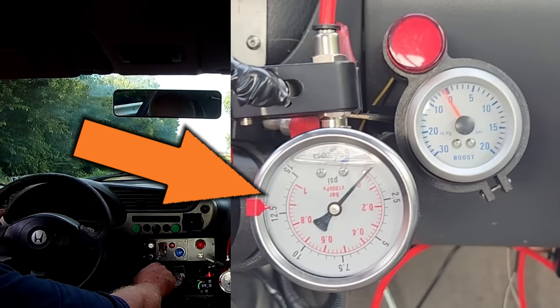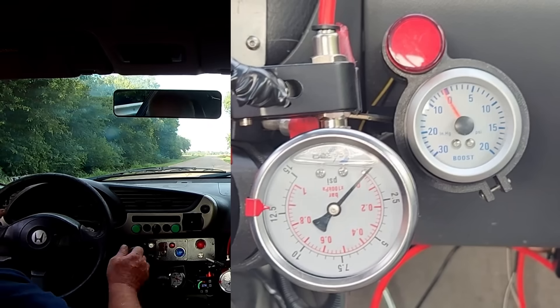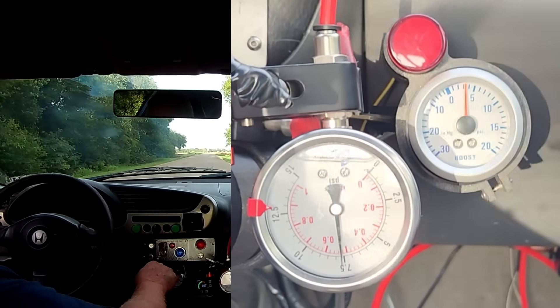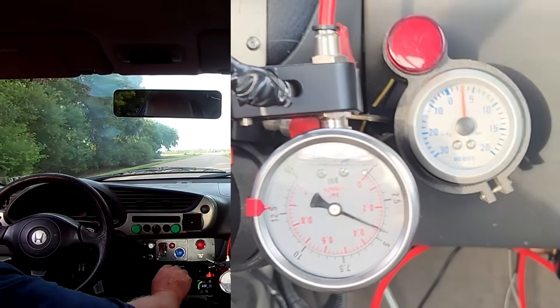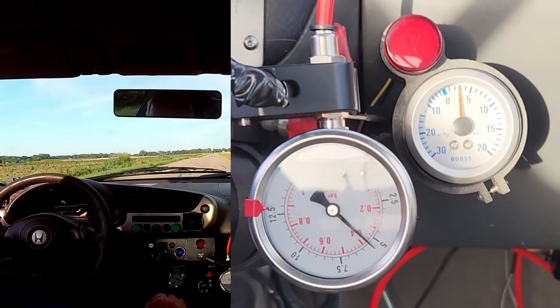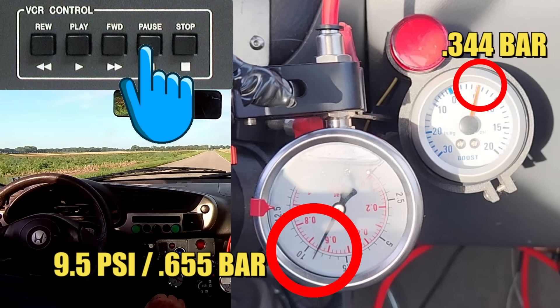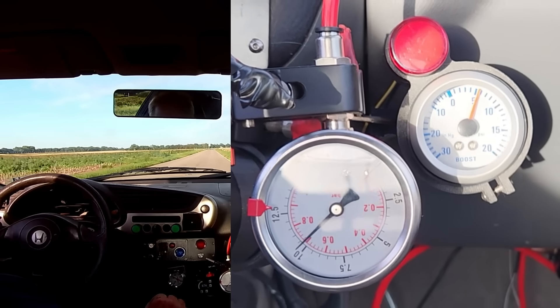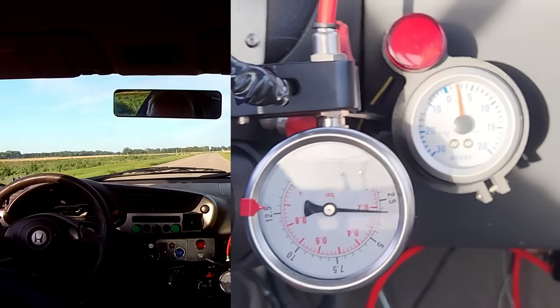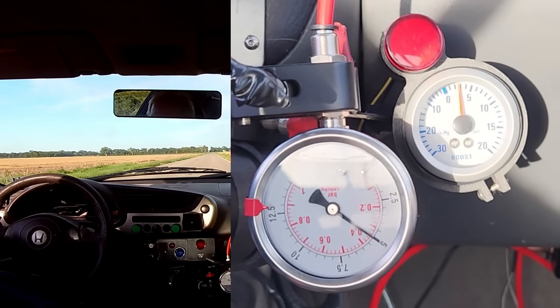Okay, this is obviously the boost gauge, and this is our back pressure gauge. Now this gauge is mounted upside down, so the folks in Australia will be able to read it just fine, but for everybody else, just be aware of its position. Now I'm going to accelerate the car normally, and we want to capture the back pressure when the boost hits 5 psi. So it looks like we get about 9 psi of back pressure when the turbo's developing 5 psi of boost. That's with the VNT mechanism maxed out and hard up against the factory-calibrated stop position. So this is a number we can use for comparison after we alter the position of the stop screw.